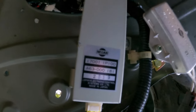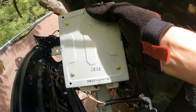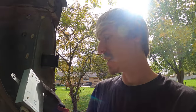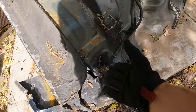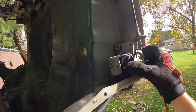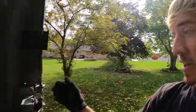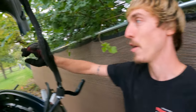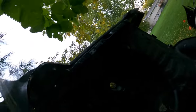Oh look, another box. A lot of you guys got back to me quickly — in the last video I asked what this box was, and some of you looked up the part number and mentioned it's a HICAS box. This is the control unit that controls the power steering for the rear subframe, and this is the pump right here. I was also curious about this throttle cable-looking thing towards the rear — someone said this was a NISMO option exhaust, pretty crazy. I forgot to take off the harness on the rear clip, but it's actually detachable — there are only two plugs, and that's the whole rear clip harness: tail lights, trunk latch, and whatever relays and modules are over there.